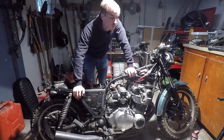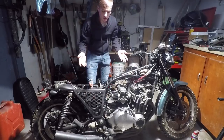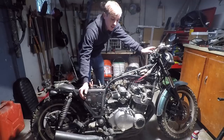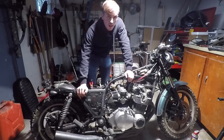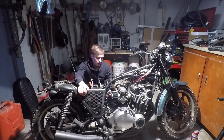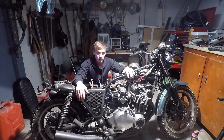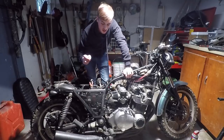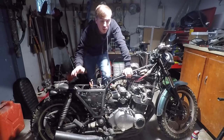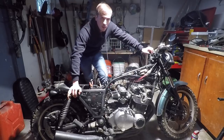At this point in real life I am pretty much finished, but I had to put this important announcement at the beginning of the video. I just recently found out that when you are wiring up a new digital tachometer to a bike — any kind of bike — you want to wire it directly to the spark generator. Your spark generator may have one to three different wires coming out of it; it's different on all bikes. Connect your tachometer wire to each of the spark generator wires until you find one that gives you a stable RPM reading.